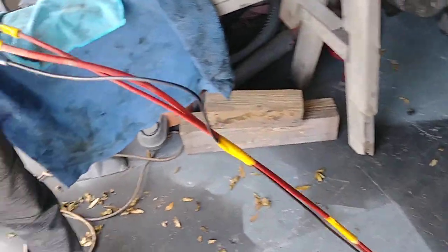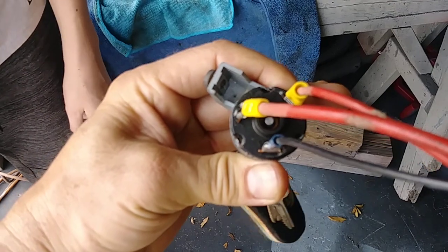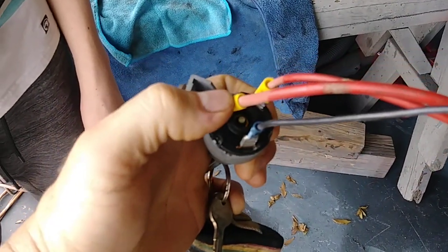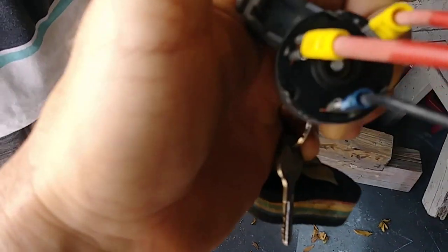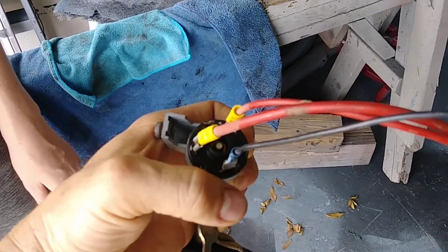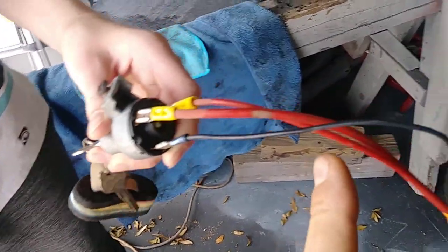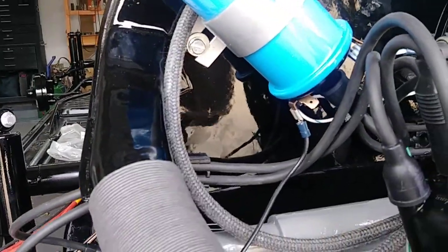The number 30 wire is the big wire here — that's hot. This is the starter wire, that's number 50. And this is the coil wire, number 54-15. The coil wire runs hot to the coil on the positive side.